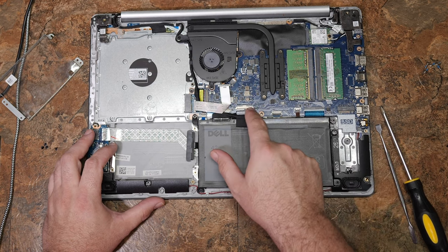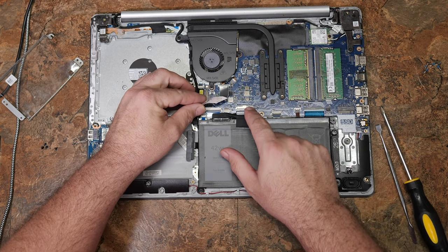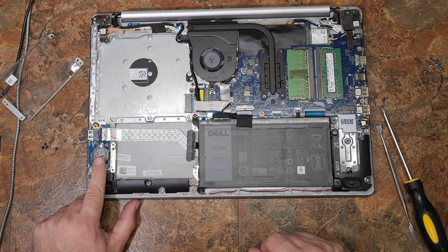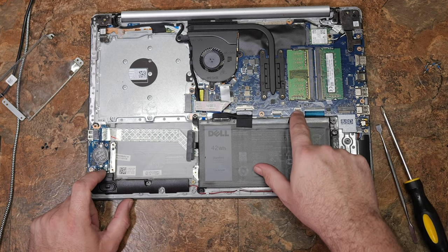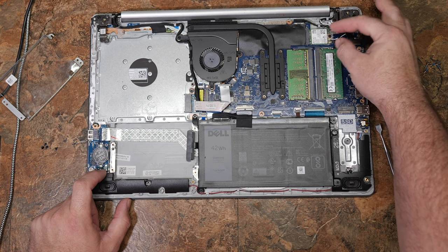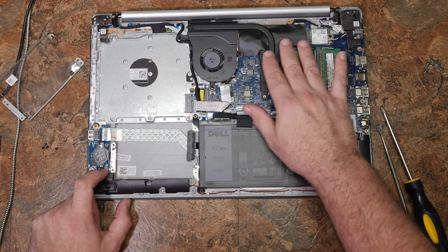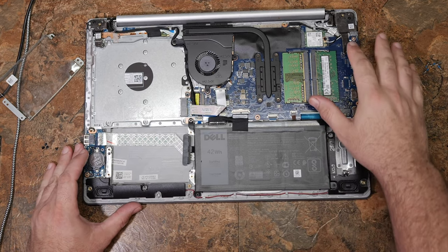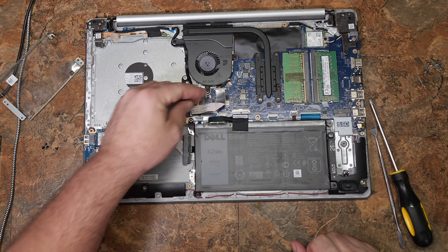You can remove the heat sink assembly but not the CPU itself. You can refresh the thermal paste. This should actually be your display cable here. This flat cable goes over to a board that, oddly enough, contains the CR2032 clock battery — I've never seen that on an external board, a very interesting choice. This is your keyboard connector and this is your backlight. There's a Wi-Fi card here — just one screw and two antennas with a retainer clipped over them. Wi-Fi antennas are terrible to put back, so upgrade at your own risk, but with care you can get them back on without breaking anything. This one has two antennas, so you can put a 2x2 card there. Overall the motherboard disassembly is pretty straightforward once you're in.